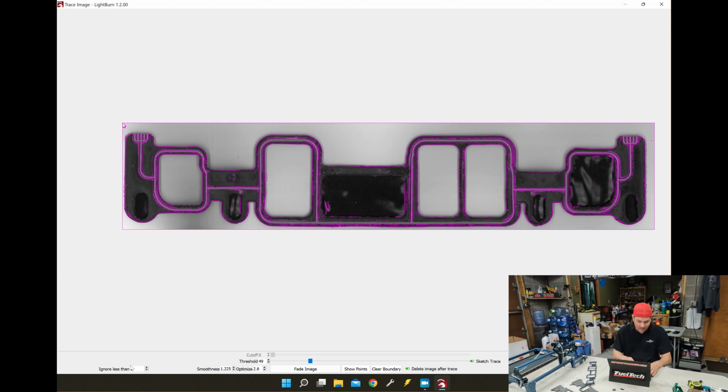And you just treat it like any other sealant. Look at how gooey that stuff is. It's amazing. Brush it on, get your gaskets laid out, figure out what side's going where. So in this case, if we were going from this to that, we would brush on a light coat on both sides, covering both completely, let it set for a while and tack up. And then we can line it up and make sure everything's lined up square and our gasket looks good.